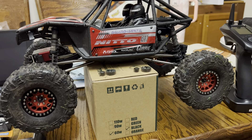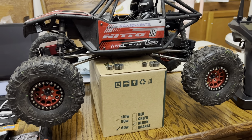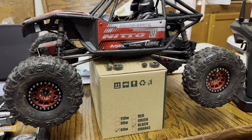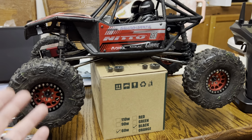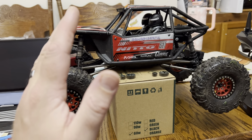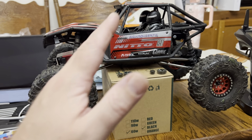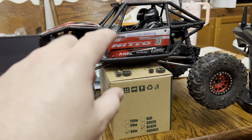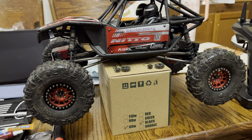I did take it out briefly — you can see the tires are a little wet. Did some quick runs, so far so good. The theory is on a steep slope, the front tires spinning quicker pull better. If you're on a hook spot, your fronts can spin faster and pull you over while the rears are just supporting the truck, not really pushing it up.